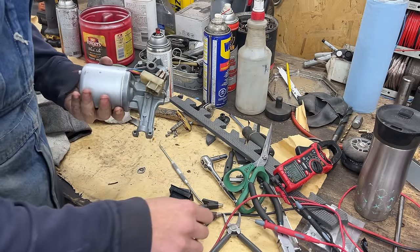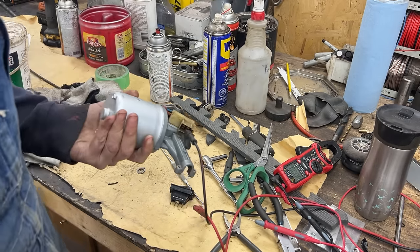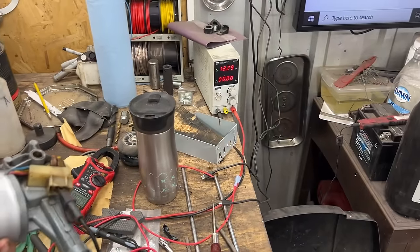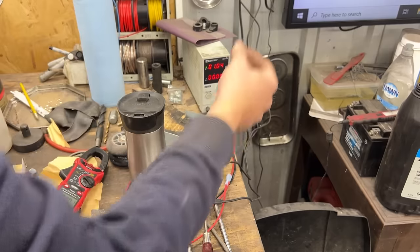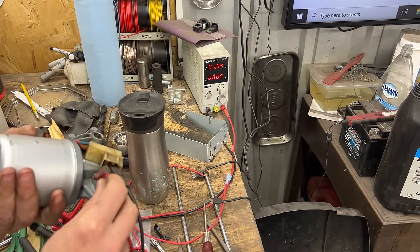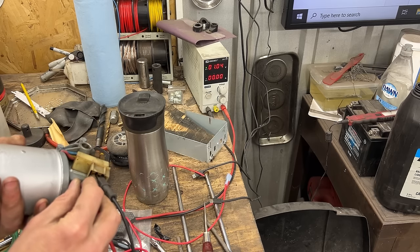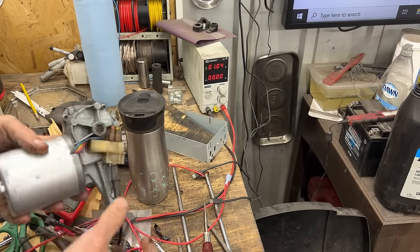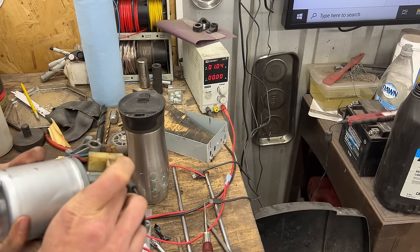To test the park switch, I'm going to lower the voltage to 1 volt. If we touch here for a second, the amperage goes high — which means I have that short circuit. But if I press this pin in and touch, now it's disconnected. So you see where we're going with that. We have ground, first speed, second speed, and at the bottom we have a switch on/off. Let's go to the schematic and explain how that helps us.